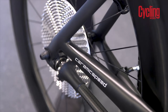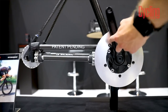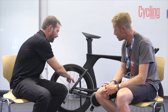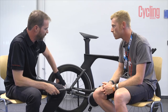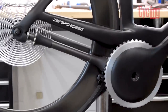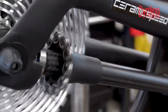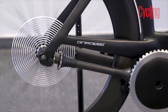On weight, they're eliminating the chain, the rear derailleur, and the cassette, replacing those three items with a carbon fibre shaft and a rear cog — essentially one plate. The current prototype is aluminium, but the production model would probably be coated steel or similar. Removing those relatively heavy, high-mass items and replacing them with these components delivers an overall weight saving.